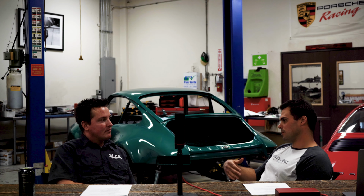And the brakes, we're going to boxer setup, correct? Correct. And that is front and rear? Front and rear. Does that run off the master cylinder? It's going to run off the 23 millimeter non-boosted master cylinder. And that would be common on which car? You'd find that normally those are used for when you're adding turbo brakes or anything that's going to be 4-piston to a non-boosted car. So it's a requirement if you're doing boxer caliper upgrades, 930 caliper upgrades, big reds, any of those require that larger master.